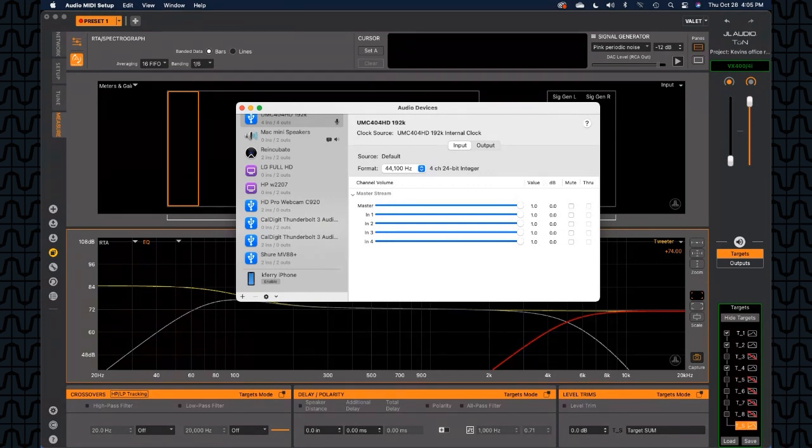The first one, it looks like Kevin has it up right now on his Mac, is under his audio settings. When we do this, we want to make sure that the mic levels are properly adjusted. This is going to be under the MIDI settings panel. If you look very closely, you can see that the inputs are up rather high. What we found is with a lot of USB microphones, when they plug in, if you look under either the Mac settings or Windows settings for your actual microphone device, the input level for the microphone is really, really low. A couple we've seen were at maybe 10% strength on the input level. So make sure that it is properly set.